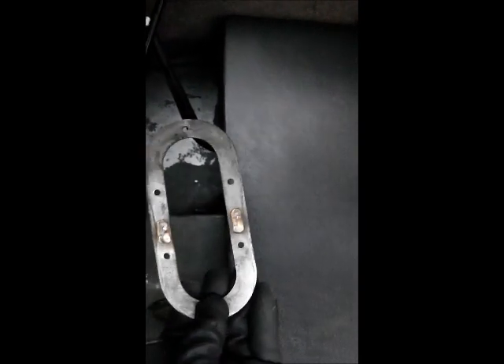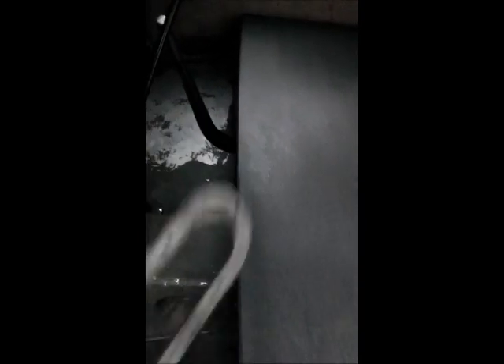The first part of the fitting is to cut out the hole for the handbrake gaiter. I've got this handbrake lock piece which I used to make some better marks. There were witness marks on the moulding but it wasn't actually in line, so I got an engineer's square out and made sure it was perfectly aligned. Cut around it — that's proved fine.